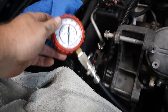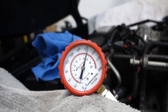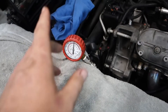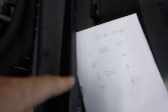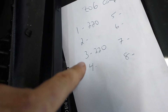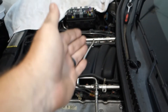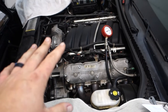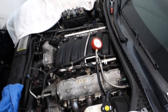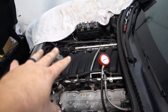We've moved everything to cylinder three. At cylinder three, we are right at about 220 again. Make sure you write down your values in the correct spot. Now we're just going to continue down the line — next go to cylinder five — and just keep repeating everything until we're finished. Now that you guys get the idea of hooking it up to each cylinder and bumping the starter with the jumper relay, I'm going to go ahead and do the passenger side and we'll take a look at the results.